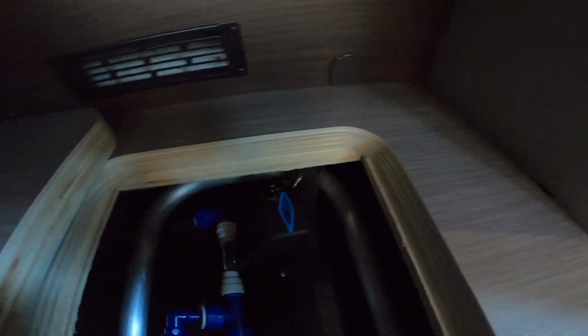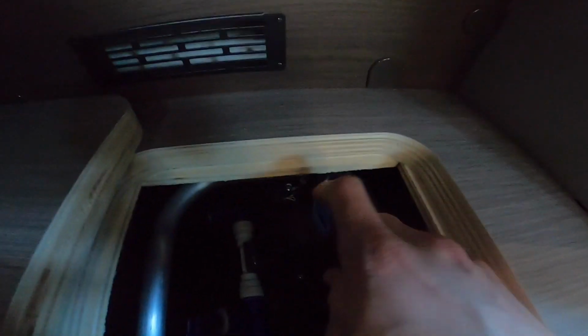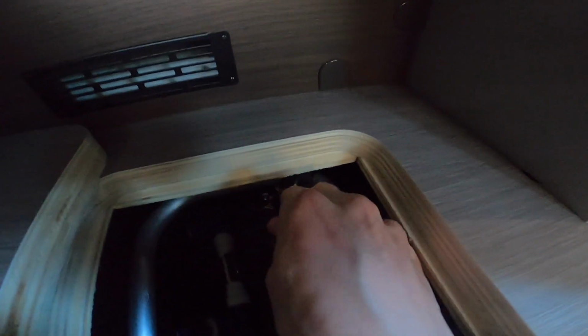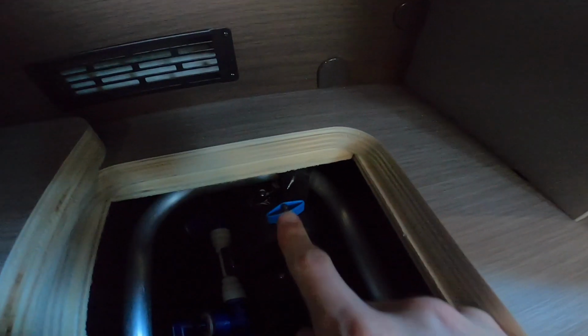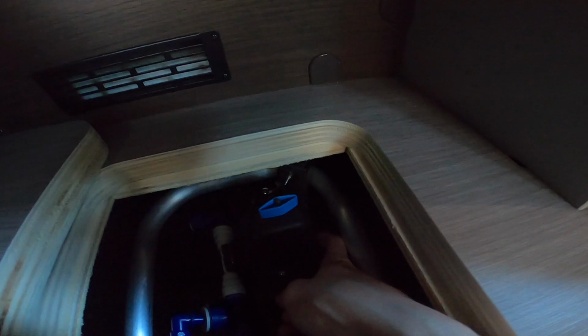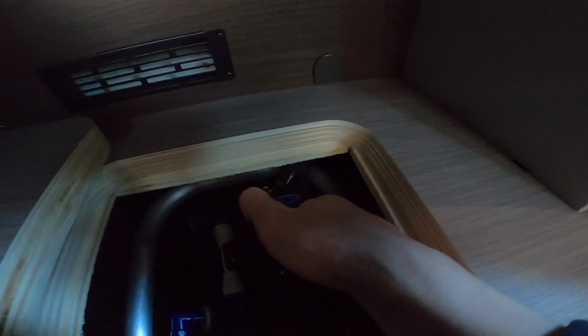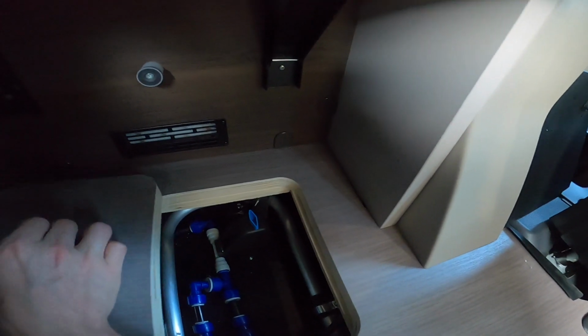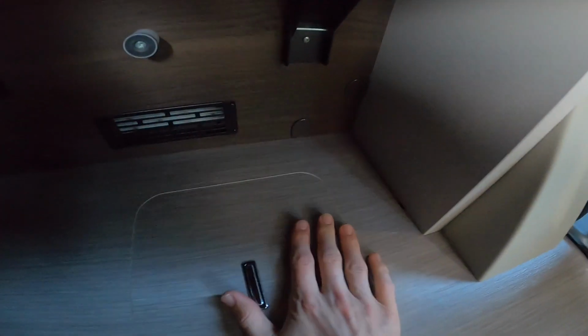Just here. Obviously when the diamond's across the van, the nib at the top's down and the button on the side here is pushed in. You turn that so it goes front to back, the nib pops out, there's a little blue button at the bottom that pops out, and that's draining 10 litres of water directly out of your boiler to stop the boiler from freezing in the winter. Do make sure you drain the boiler off, open any pipes as it's not covered under warranty, as it's your responsibility to drain the vehicle down.